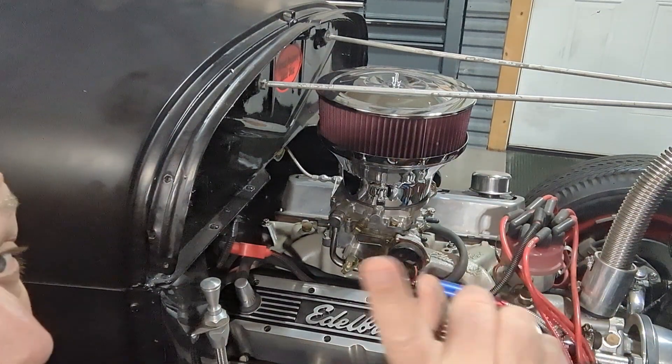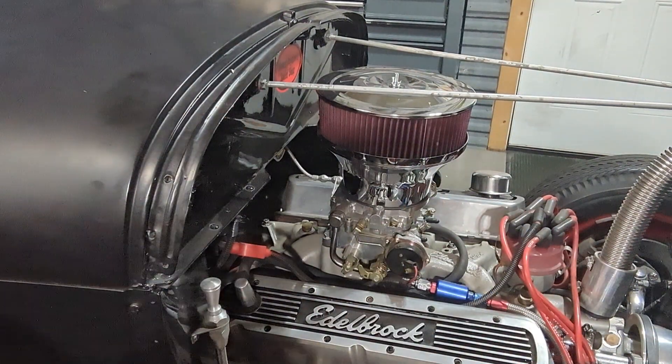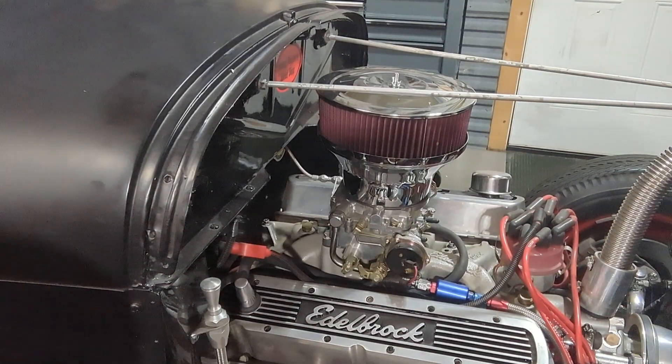Now for oil — there is an oil leak. It's right under here; the drain plug actually drips just a little bit. I also found that the rear main seal drips just a little bit. I do know why they're leaking. I'm not going to address the oil pan plug because I haven't changed the oil yet. Once I do that, I'll put a new plug in there or see if the gasket's cracked.